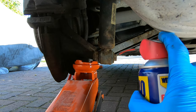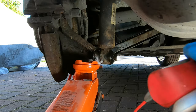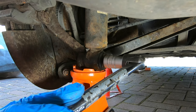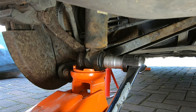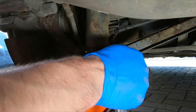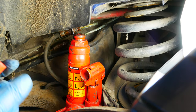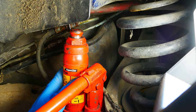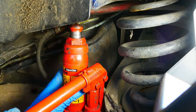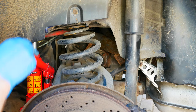I'll get my friend WD-40 on the job, then get a breaker bar in and let it do the heavy lifting, and then we can get a ratchet in. These little bottle jacks are just cheap as chips and they come in super handy — if you don't have one in your garage then you should. Hopefully that'll just take the tension off of that spring.